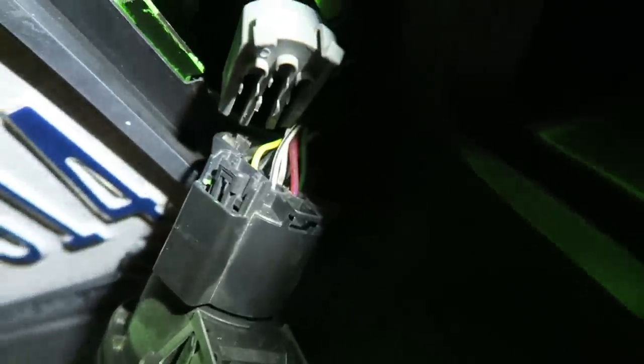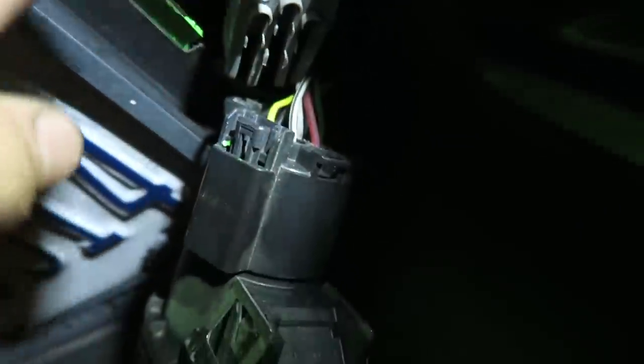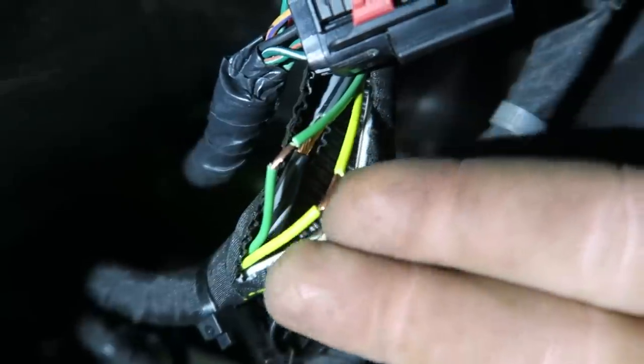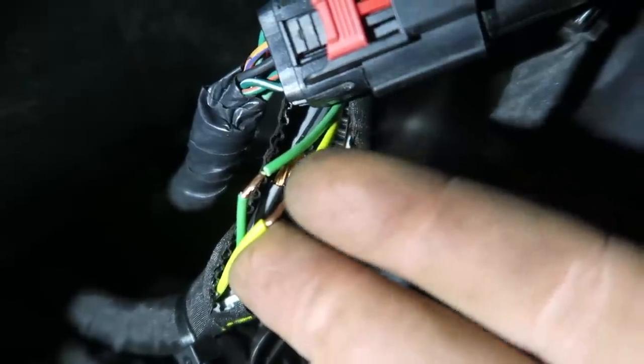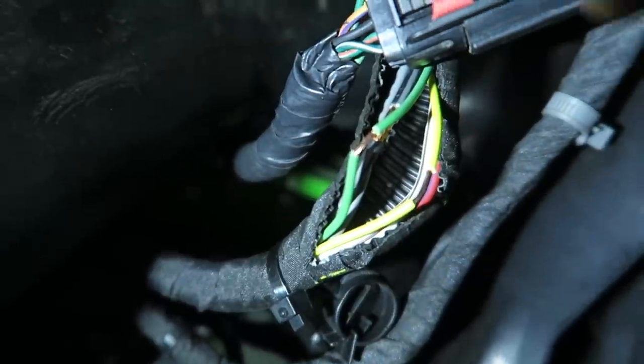I popped the trailer plug out to see the wiring — it's labeled on the front so you can see what wire goes where and match it up in the harness. There are two white-and-brown wires, which was my only confusion. If you want the wiring schematic without deciphering this yourself, I'll put everything in the description. We'll just test both white-and-brown wires — one's in the center pin of the trailer wiring and the other's in the bottom left or right. To splice in: make two cuts in the protective coating with a small space between, slice from cut to cut with a razor blade, unwrap the coating, wrap your wire around, and tape it back up.